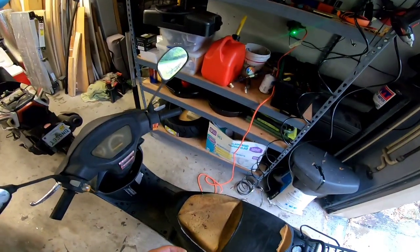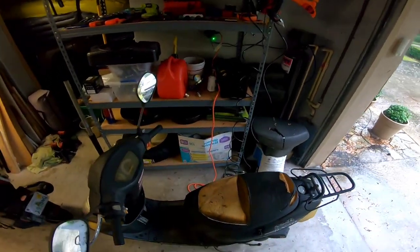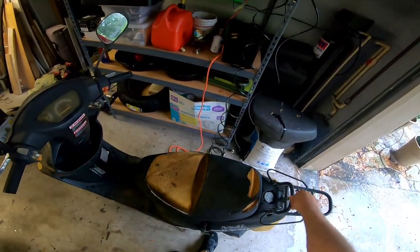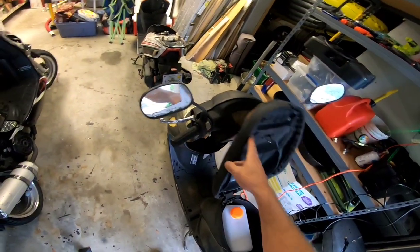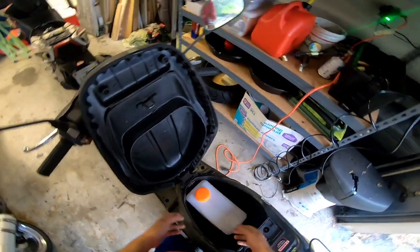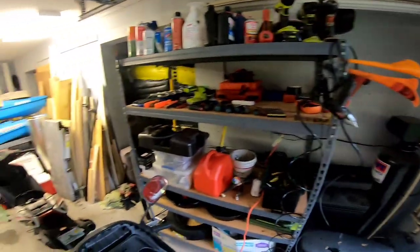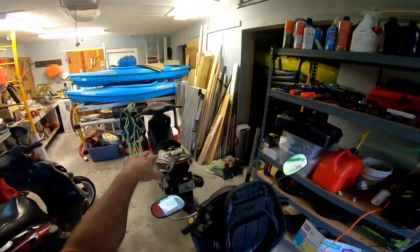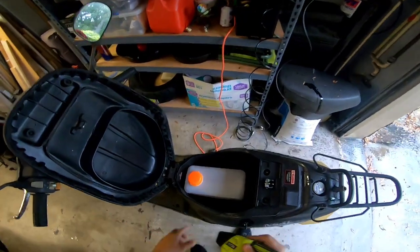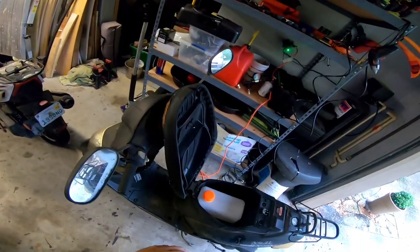This one I did some work to - let me unlock the seat. So this fuel tank had failed and I noticed that the plastics were already very brittle, so I didn't want to remove this gas tank due to the failure. What I decided to do was buy one of these $18 fuel tanks off Amazon. You have to install a little fuel reservoir yourself. It's a much larger gas tank - they're $18 and they work great. They have a little breather on the top. Basically you'll be converting the scooter to a gravity-fed system instead of a petcock vacuum-driven system.